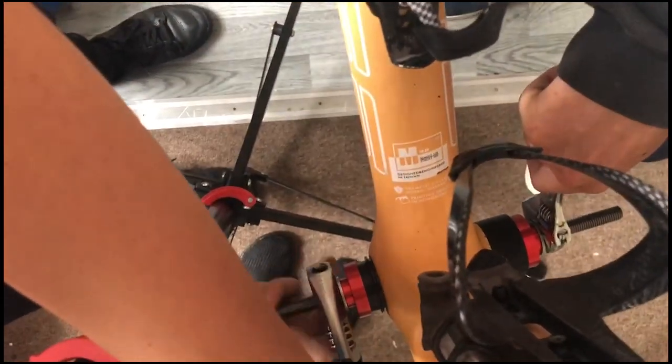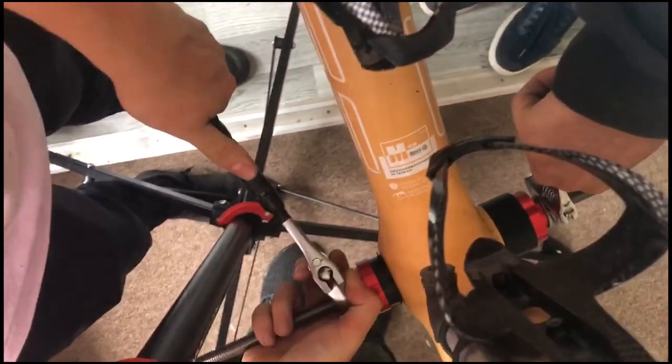We're going to skip forward a little bit here. You can see my friend helping out, just double checking that everything's in. You just need to make sure it's well aligned, but that is actually not too hard to do. It is just more twisting — it's almost in now, but it starts to get a bit more stiff and harder to put in the closer you get, just because it's a one piece design and frames are normally designed for the classic Shimano two piece design.